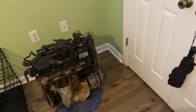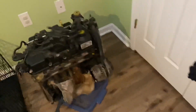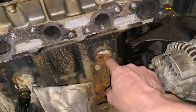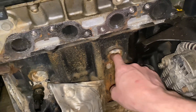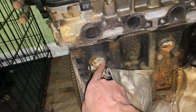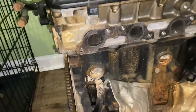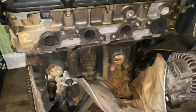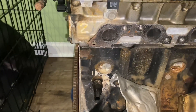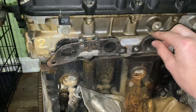I really would have preferred brass over steel because brass does last a lot longer than the steel does, because as you can see steel eventually rusts out, and this one actually has a pinhole in it. Now it looks like that had been leaking for a while. The manifold gasket's still on there — not for long. Hey, while we're at it let's peek inside the exhaust ports and see if we can see the valves.